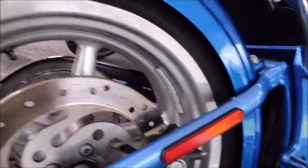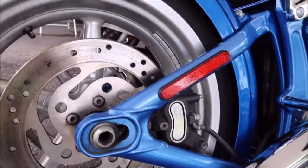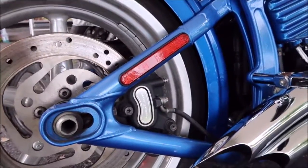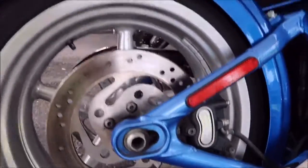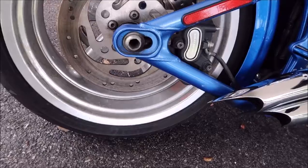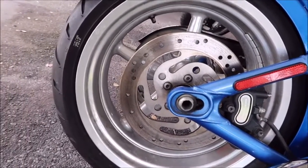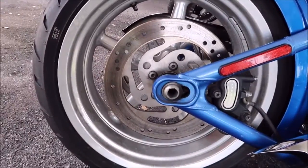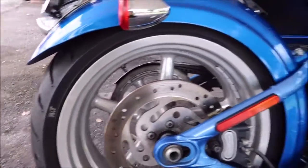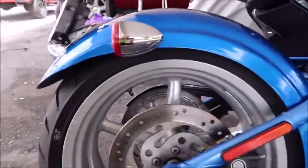You can see the wheels did not come out fantastic. The brake dust is like embedded inside the clear coat on top of the aluminum. Best way to clean that wheel up literally would be to be able to polish the whole thing — scuff it up with maybe 2500 grit and then polish it out. Either that or pull the wheel and hit it with some aircraft stripper and strip all the clear coat off. Then it can be hand polished to look similar to the chrome, but that's kind of a lot.